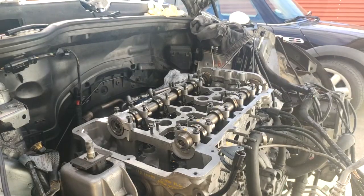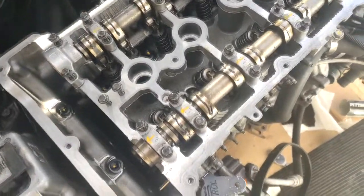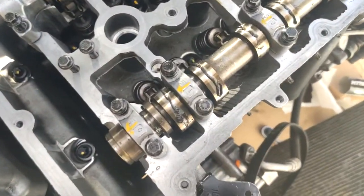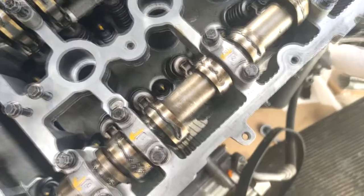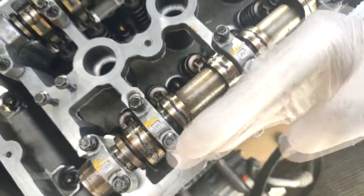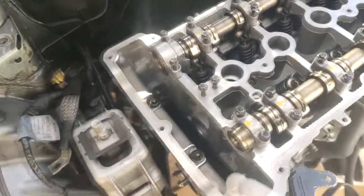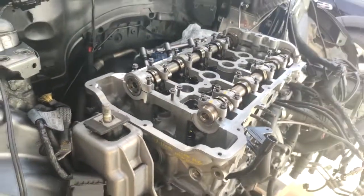As I've shown earlier, you mark the bearing caps so you know which direction they go. They also have a numbering stamped on them — 0, 1, 2 — and notice how the numbers are written going upwards and downwards in this direction. It's easier just to make arrows on all of them so you know they all go facing the front of the engine, which is important.